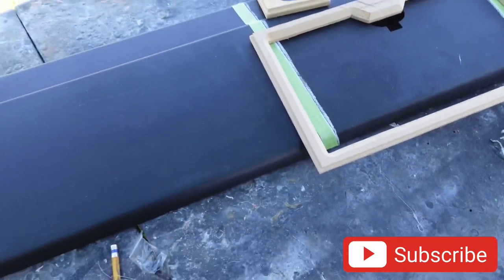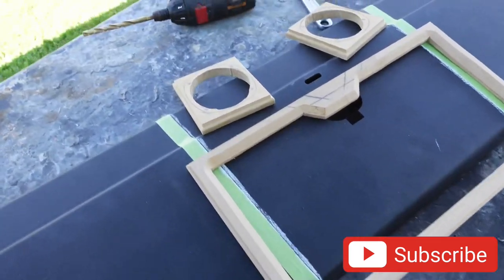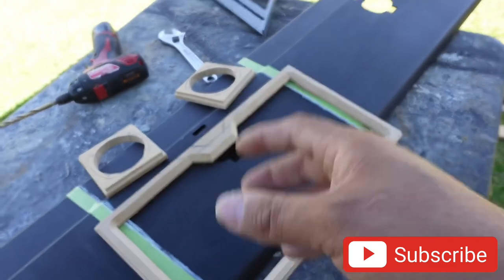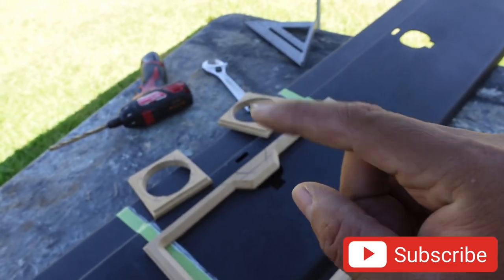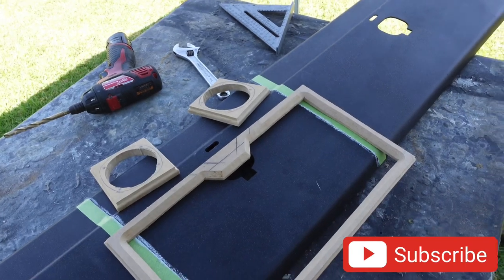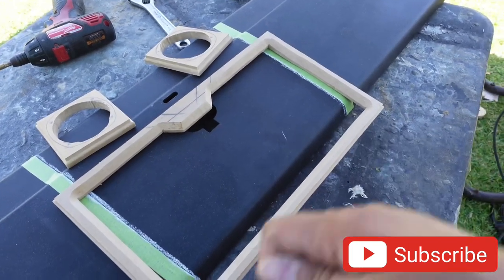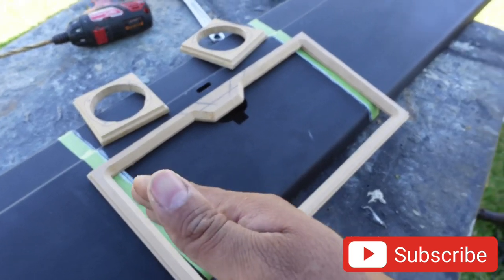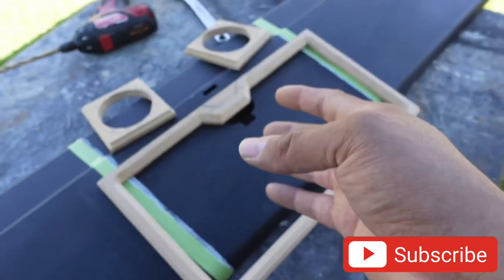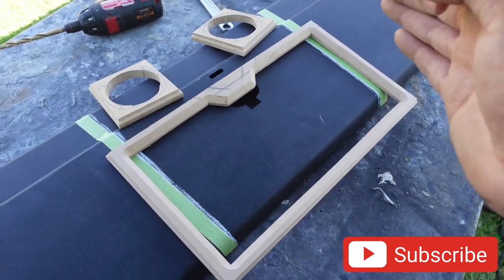When we wrap it in vinyl, that's going to be a key focal point. That little router bit — I usually just use round-over and the fan one, but I had this smaller one for a previous project. I used it for some braces with inner cutouts with little designs, and I couldn't put the big bit because of the bearing, so I got the smaller one just to give it a little round-over. For this one we actually used it for our outer lines — when we fleece it, we can have a staple line, and it did a straight-up router versus the other bit that gives more of a round look. So it actually worked better because we're looking for the square look versus rounded.